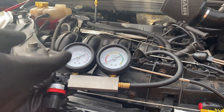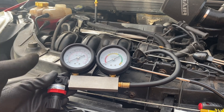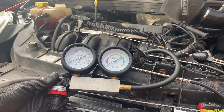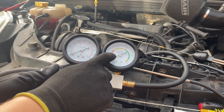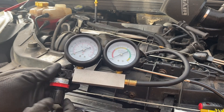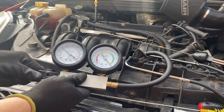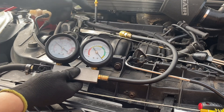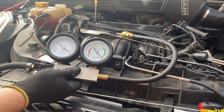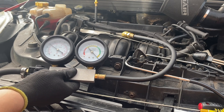To set up the leakage tester, this one requires between 45 and 100 psi supply from the compressor, which I've already set up. I just need to adjust the dial until the needle comes to zero in the set area. Then I connect the tube to the one in the cylinder using the quick connector, and we can measure the percentage leakage and listen in all the different places to see where air is actually escaping to.